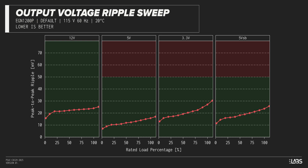The peak-to-peak signal ripple of the fully loaded power supply's 12-volt rail was better than average for its price and wattage at 24 millivolts. The 5-volt and 3.3-volt rails had signal ripple of 16 millivolts and 27 millivolts respectively. Modern power supplies typically have no issue complying with ATX ripple specifications, and this unit is no different.